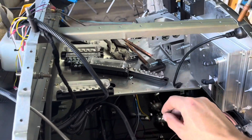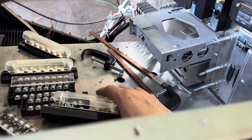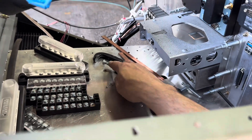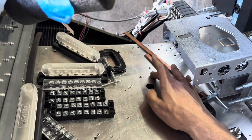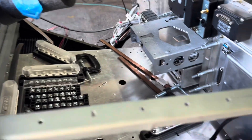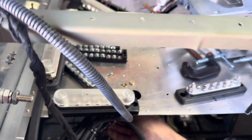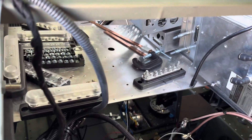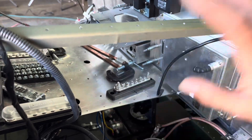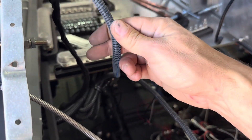I think what I'm going to do is have most of my wires come up and around and then disperse to everything. I also have a central hole somewhere on this panel that I'm going to make quite a bit bigger so all my wires can get fed back down through here. My ECU is still staying where it's at — perfectly mounted and secured, soft mounted. Then we'll start working this out and getting all the interconnected wires cleaned up and wrapped neatly, maybe with some loom tube or something like that.